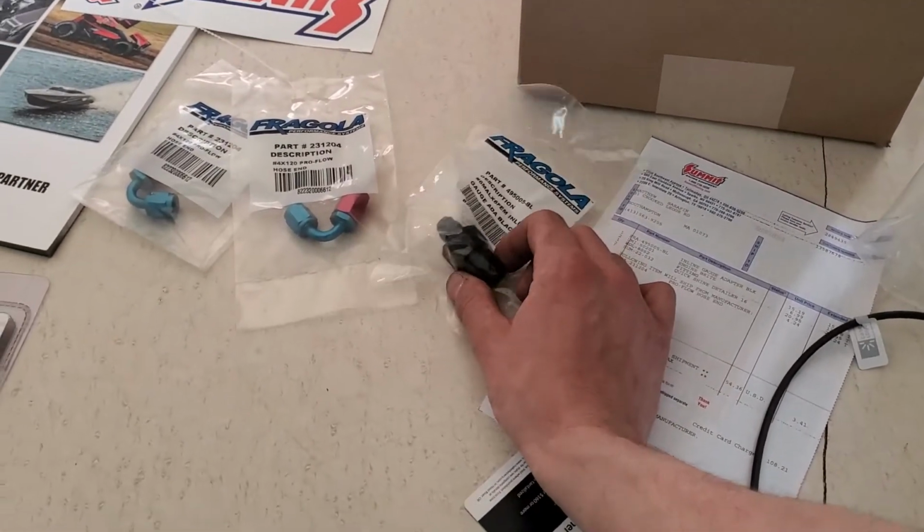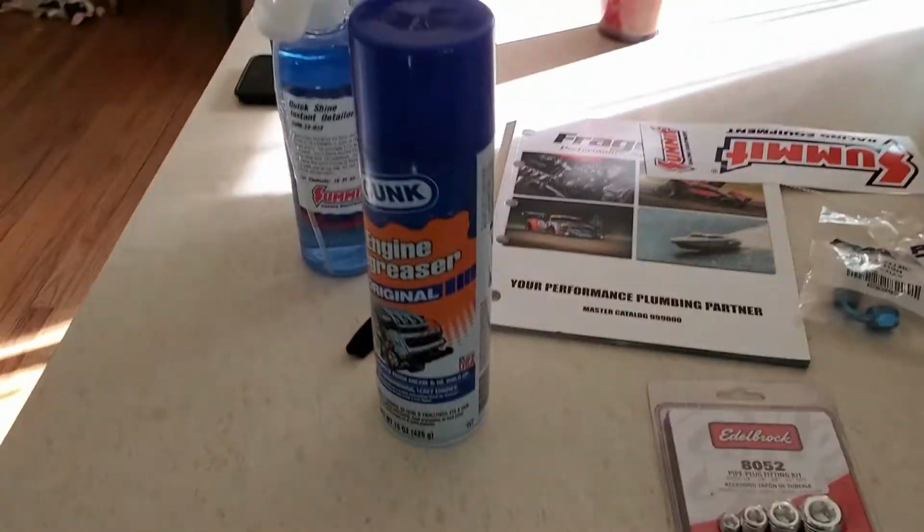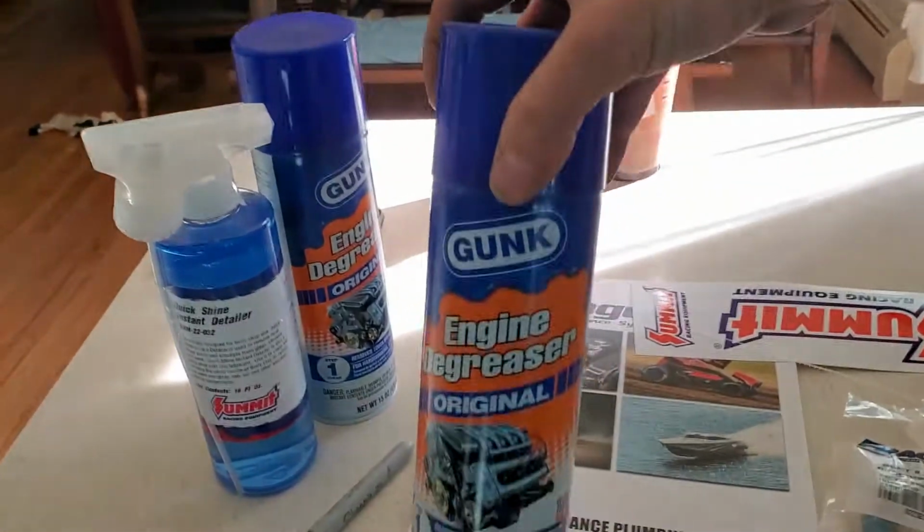I got a gauge adapter I'm gonna put on my turbo because I've had some problems keeping turbos alive. So I'm gonna toss that onto my data logger just so I have oil pressure in the engine, and then I'm also gonna log oil pressure at the charger, see if that changes throughout the pull or the season, or if I end up losing a charger, I can just look back at that, just another point of reference.